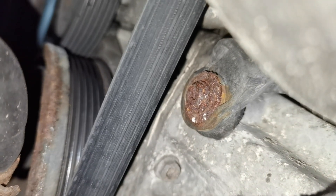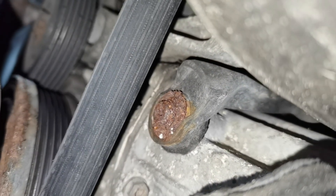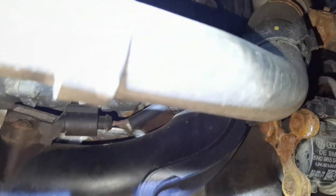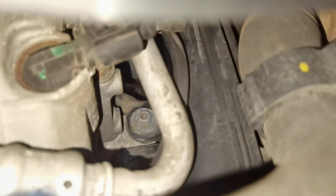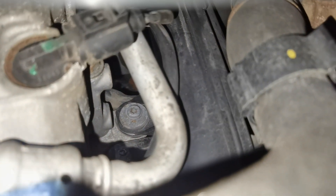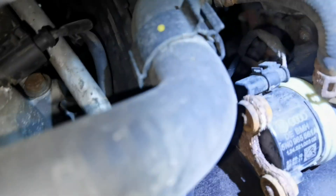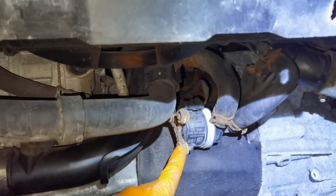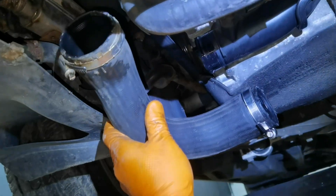To replace the auxiliary water pump on a 1.6 or 2.0 TDI engine, you'll first have to remove the screws securing the tubing that runs from the throttle body to the intercooler. You'll have the first screw on the left side right underneath the serpentine belt, and the second one underneath the AC compressor. This one is a little difficult to remove but it can be done without having to remove any other parts. Last, you'll have to remove the hose mounted to the throttle body at the top of the engine. I also recommend removing the hose from the left side going into the intercooler.